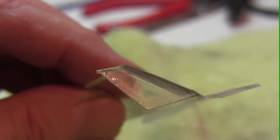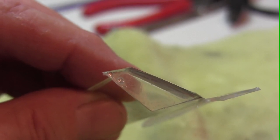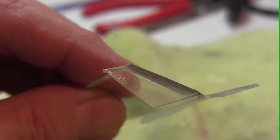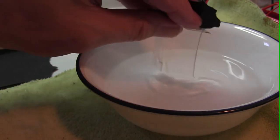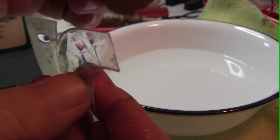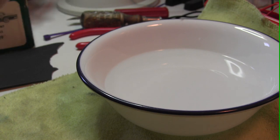The side of the glass has some glue left on it from a bad repair, so the first thing we're going to do is get rid of that glue — we're going to have to sand it down. We're probably going to start with around 600 grit. We're going to do some wet sanding and work the grit up until we eventually get it ready to be polished. A little piece of wet sandpaper, get it a little wet, get the window a little wet, and go to work. When you're doing this, you want to make sure you don't get overzealous — just do the minimal amount you need to remove what you've got to remove.